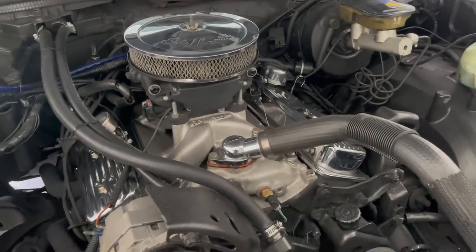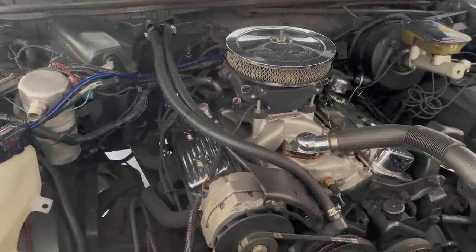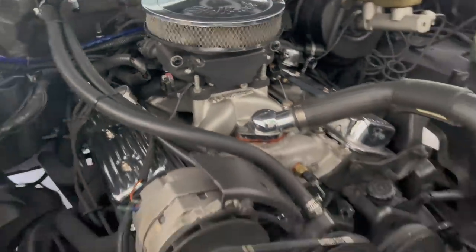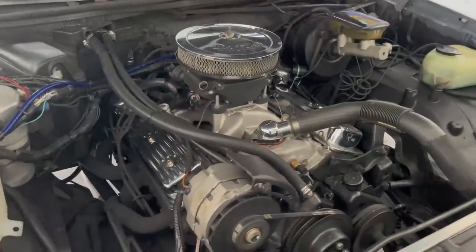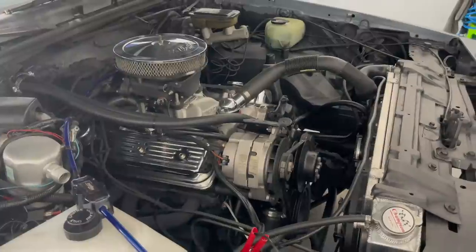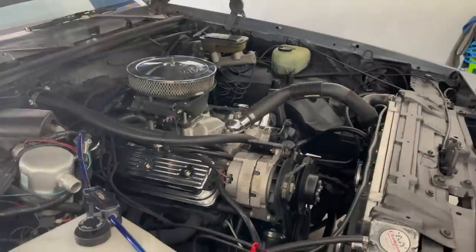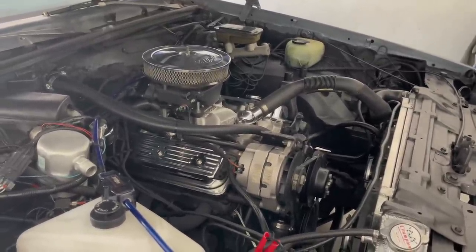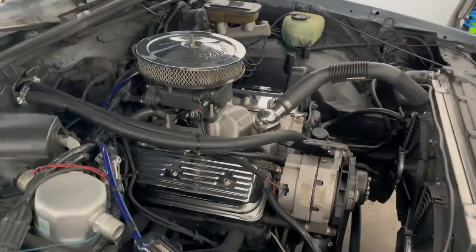So you say you run one fan turned on at like 170, right? Yep. So he's got his fans set up so you stay cool. Can set all this through the Sniper too. So the first fan turns on at 170, and then the second fan turns on at 185, if it even gets that hot. It don't. You running at like 178 or something? Nah. Summertime, I can't touch, but right now, about 173. So we'll just say he's running at about 170.